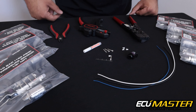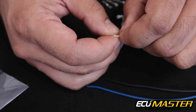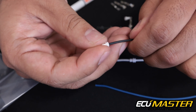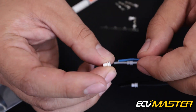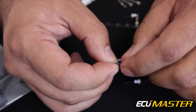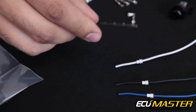Before we strip these wires, we're going to take the weather seals and put the wires through so that we don't have copper strands stabbing us in the fingers as we work later. This prevents fraying at the end of the copper. Also make sure that you do it before you terminate the wire into the terminal itself — it is a real pain in the neck to have to redo stuff after you've already crimped the terminal onto the wire.